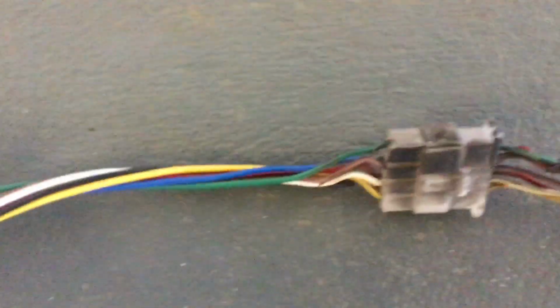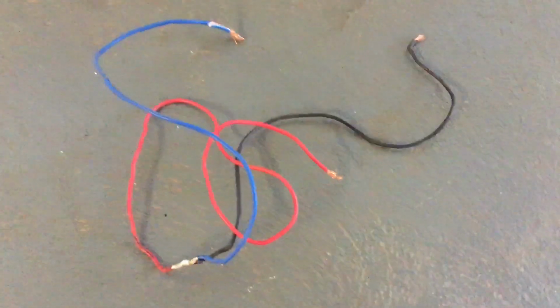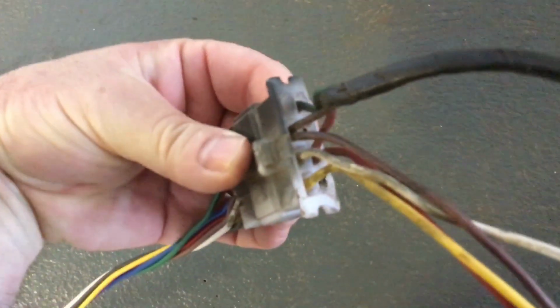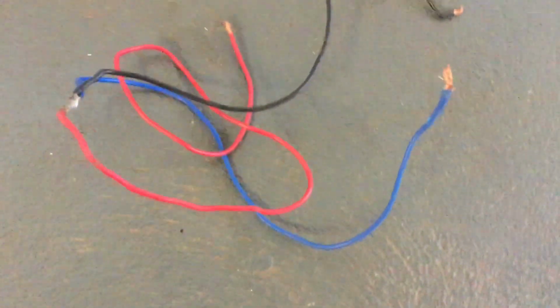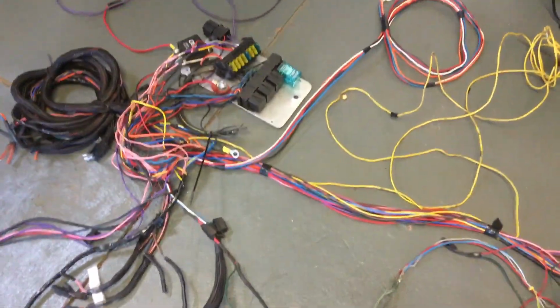So earlier in the video when I mentioned my fuel pump, that is the wiring for my fuel pump that all came along this loom, this pre-bought loom, where hardly any colours really correspond. And that's the wiring for my Aeromotive fuel pump that I pulled out. So that was all into the back of that plug, and yeah, rewired it. What else? Some other bits and pieces we pulled out. So as you can see, there's not a lot to like about this wiring. Some of the wires change size when they're joined on, so different gauge wires.